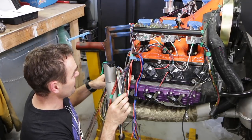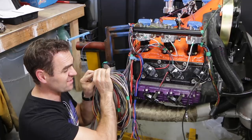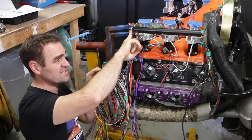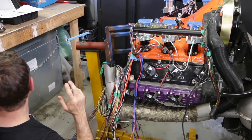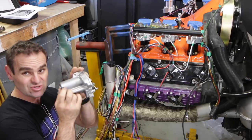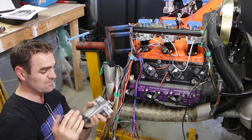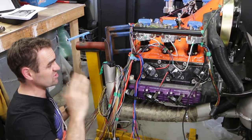This looks like a massive bird's nest now but it's actually getting pared down quite nicely. The bulk of what's here isn't necessary — there are a few more wires I still need to track down. I've got to talk to Link and work out exactly what I need for the throttle position sensors, because at the moment there's one TPS on the butterflies themselves, but with e-throttles there's a second redundancy TPS built into the electronic throttle actuator as well. I need to work out whether I should have both connected as redundancy. There are also MAP sensors still to go in, but I don't have the ECU itself yet so I still need to sort that out.